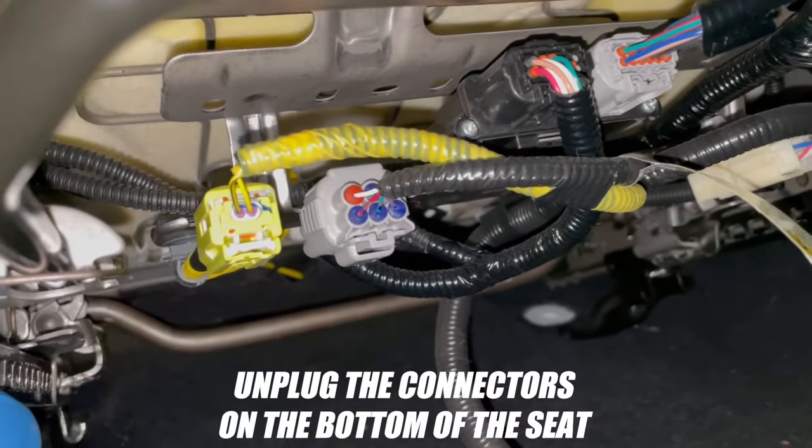You've got to make sure to unplug these, obviously, for anyone that doesn't know. You push the cushion towards the center of the seat and you're able to get to the bolts. There's one right there, and then there's one up above right there that you have to take off.